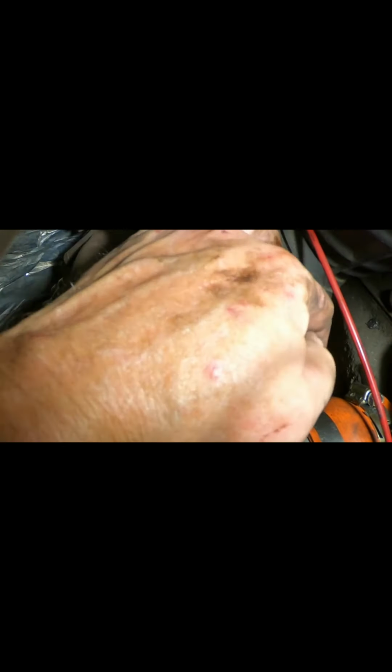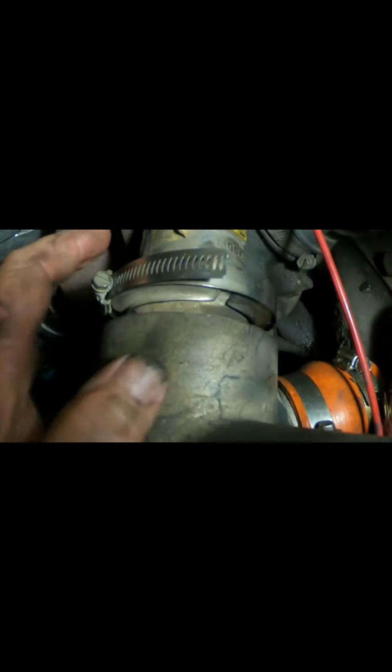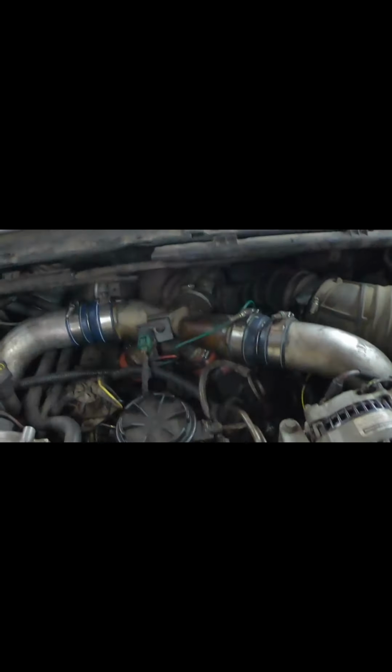Alright, well, it's right here on this turbo. The sound changes when I get my hand on it. I've only got about 10 psi on it right now. Run the pressure up too high, the compressor runs so much, and you can't hear nothing when the compressor is running. But that's where it's at. There's a little seal in there. Those things fail sometimes. If I can't fix that.